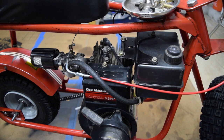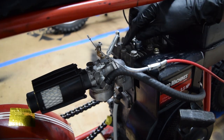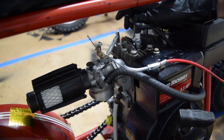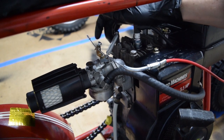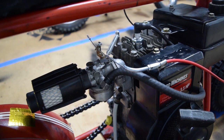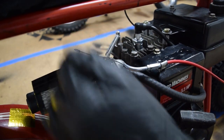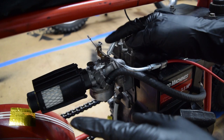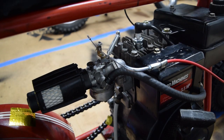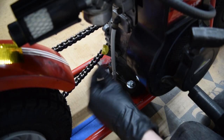I'm super excited to get this thing done because I want to ride it. It's supposed to snow in the next couple days, so we may even be able to ride around in the snow. I got the throttle return spring figured out - I drilled and tapped both studs just to accept a bolt, and used the back one, which required trimming down one cooling fin. It works pretty well, sometimes it doesn't return, which just adds to the sketchiness. The spring initially had an 8-inch section of spare wire for adapting, I trimmed off that extra wire and used it down here. It's not tight but it's secure enough that it'll be fine.